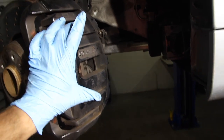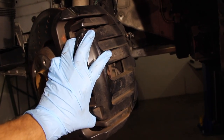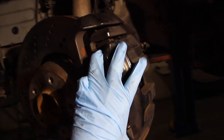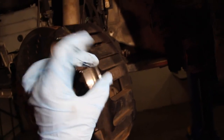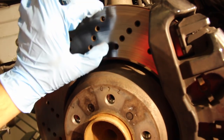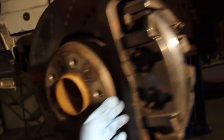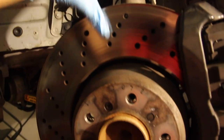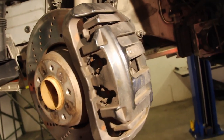With the two pins out and the sensor disconnected, there's really nothing else holding on the caliper at this point. Now, depending on how worn your pads are - if your pads are worn way down, the piston or pistons in this caliper have moved out. And if you've got a big lip on the rotor, that means your pads right now are resting inside of that lip. So if you try to take the caliper off, you're going to run into the issue that it's going to hit the lip on the rotor and it's not going to come out. You need a C-clamp - it's got to be a pretty big one, seeing how thick this caliper is.